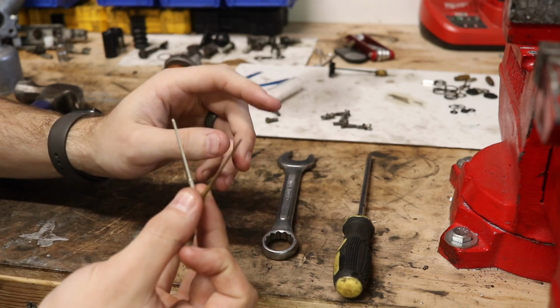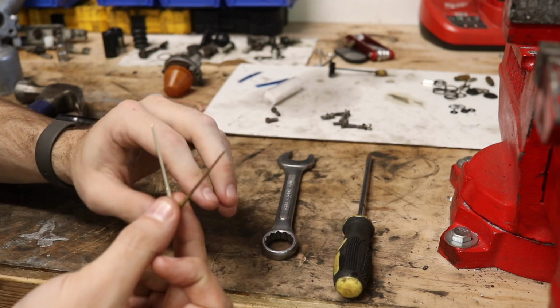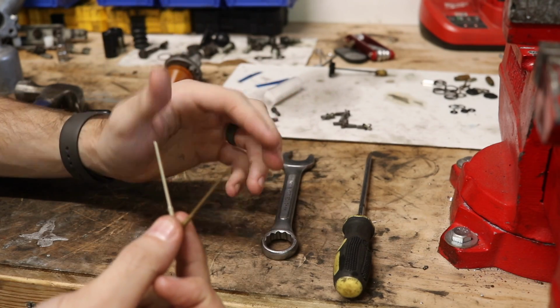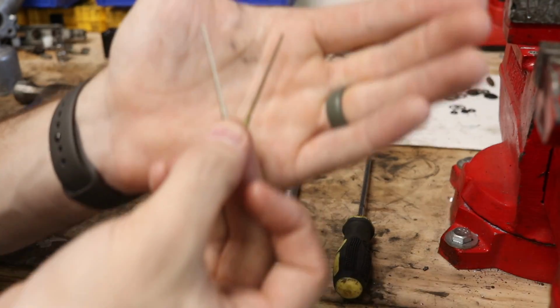The other reason I'm replacing them is because I'm looking for something a little bit richer, that's going to deliver more fuel with the air mixture so that I potentially could get a little bit more power out of my bigger displacement and my fast hot cam that I have on there. So hopefully that will yield some benefits here.